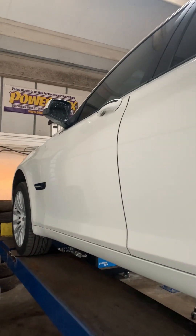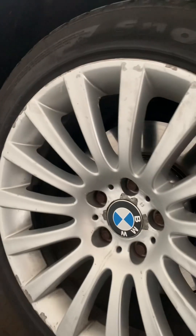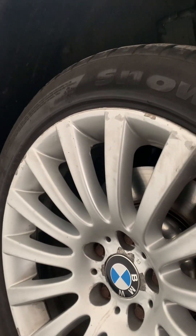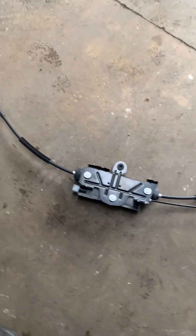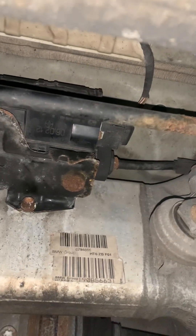We've got a BMW 7 Series that recently had discs and pads replaced. When the car was put into service mode it came up with a yellow cog handbrake fault. There's an emergency pull in the bonnet to release the handbrake - the handbrake did actually get stuck on. We're going to replace the module; this is what it looks like - it handles both handbrake cables, a big and expensive part.